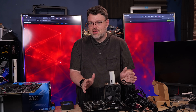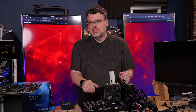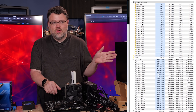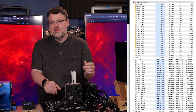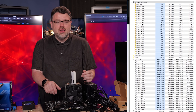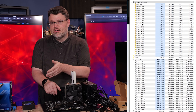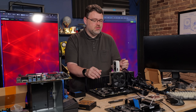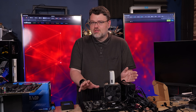The back plate lets you have a slightly different setup, and that does make your CPU a little taller when you use the IHS, so you have to be sure your cooling solution supports a slightly higher CPU. Generally AIO coolers will do that, but with something like a Noctua LGA 1700 it's pushing it a little because the threads don't quite want to catch. The other option is the mounting frame — if you get the mounting frame, use only the orange screwdriver and reuse the screws that came from the socket. That's the magic, and I found it actually worked better. You are basically doing direct die cooling with what is essentially a desktop-class CPU. Hardware info 64 shows voltage requests going up to about 1.4 volts and change for this 5.0 GHz or 4.8 GHz processor out of the box, which opens up a lot of interesting possibilities.